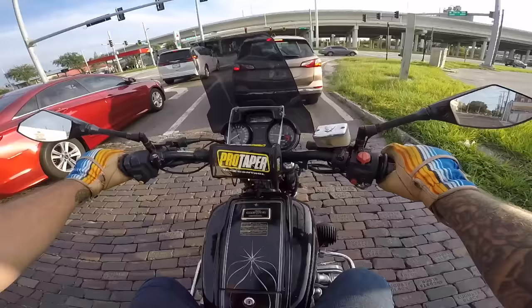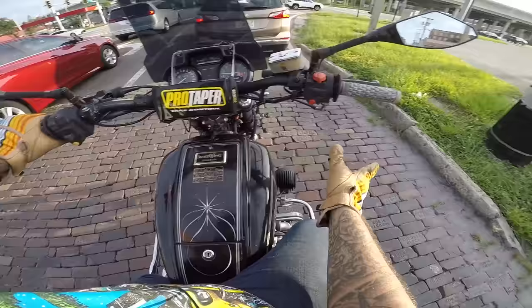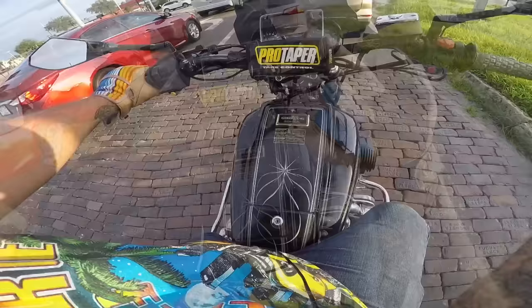So I'm finding with the rear brake, I still have the proportioning valve on there. There's a valve that sends a certain amount to the front and a certain amount to the rear. I feel like I have to press it harder to get the same performance out of it, but it is working, and I tried it off-road and it will lock up the rear tire. I don't know, it might be something funky going on there, but really all I have to do, like Joe the Mountain Jedi told me, is get a line made that goes from the master cylinder straight to the rear brake, instead of that proportioning valve, which I think is part of the problem right now.